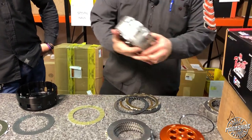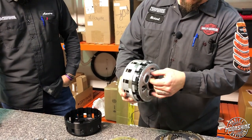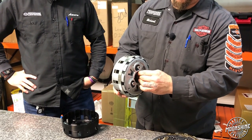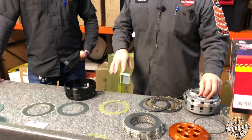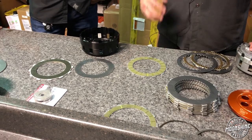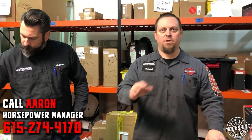There are also different designs in the pressure plate itself, which holds everything together. Here's the stock type — it's a limited-slip plate with little blades that help absorb some of the shock of the drivetrain when you're coming in and out. It kind of rides on a ramp, making engagement a little softer. Manufacturers have to deal with EPA regulations — not just what comes out of your tailpipe, but the engines themselves have to be under a certain decibel level to pass EPA standards. A lot of what they do is dampen these friction points to eliminate noise.